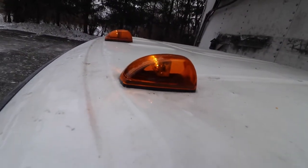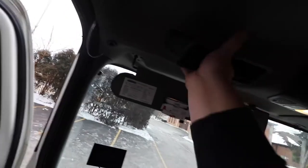I'm going to turn the lights back on — it still works. So if you have big hands, guys, you're screwed because it sucks getting up in there. That side's done. Let's pop this panel back in — just wiggle it in there, boom, one done, two more to go. For the middle light, there's going to be a bolt here, here, here, and up here. I might have to remove the box for the reefer temp control. I'm going to buzz these off with the gun — it's a T25 for the bolt. Once I get that done, I'll see you guys in a second.